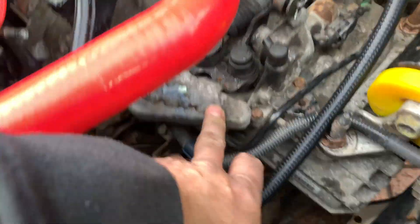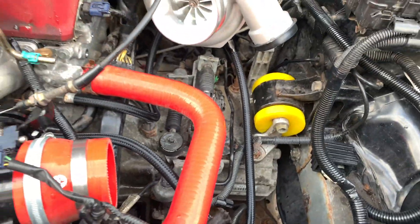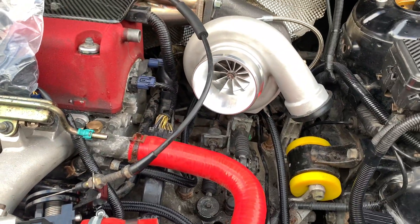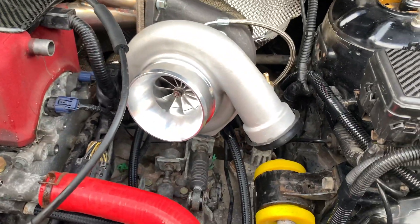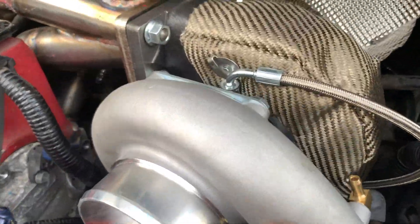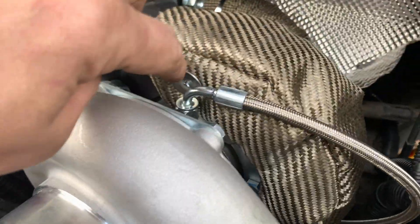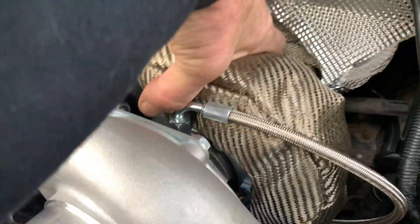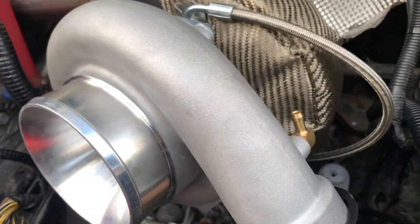It's definitely going to be out of the way of the gear linkage, which could pop your water hose, so I'm happy with them. That means I've just got the oil return to do, which I'm probably going to leave until tomorrow because it's getting cold and it's raining. I've also got this cool turbo blanket — I've just rested it on there. It's got springs in the bag that clip it on, and that will help with bonnet temperatures.